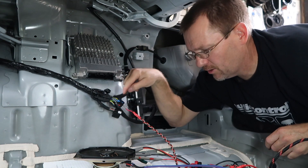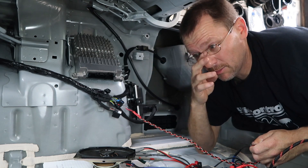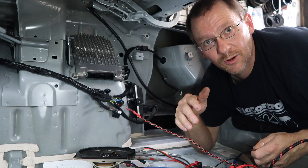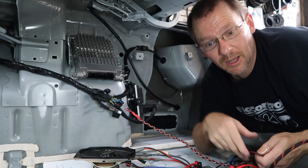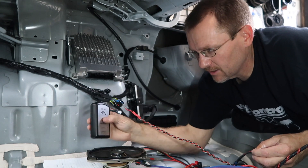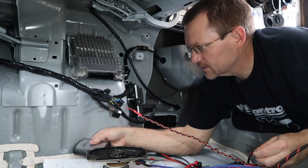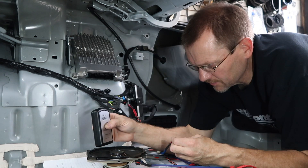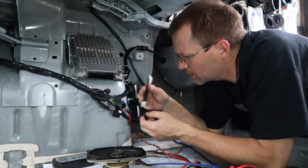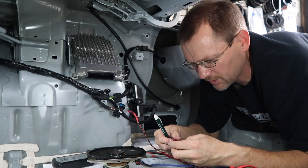We've plugged some wire into the harness and connected our test speaker. We play a polarity pop sound — we have it on DNF Tool Drawer, and there are also apps like Speaker Pop for your phone. The PT9A measures the air coming off the speaker and tells you if it's in polarity or not. It lights up green — we know we've picked the right color. In this case we had it backwards first, so we switch them. Blue with brown-white is confirmed positive. We'll move on and repeat the process on all pairs.